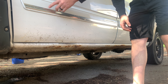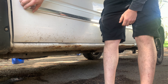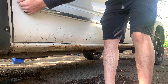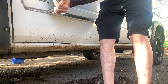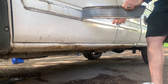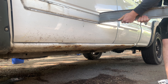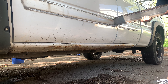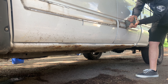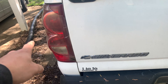First I'm just going to pull these off. When it comes to side molding or anything like that, mostly you can just peel it off. I already peeled it off on the other side. Just be careful — mine's a pretty old truck so it comes off fairly easy, but if you have a newer truck I don't know how strong the adhesive is going to be, so be careful with your paint. Go slow and easy and you'll be all right.